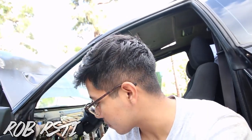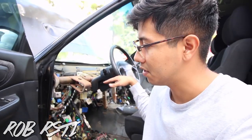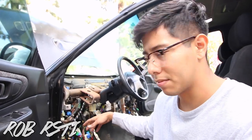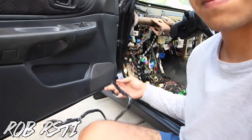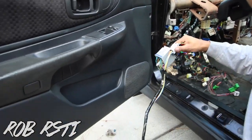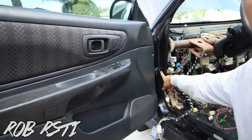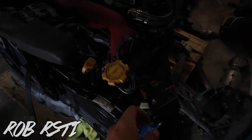I'm gonna be doing the fuel pump last. I'm not gonna be plugging in the driver side because I'm gonna have to remove the steering column from the steering rack and unplug it and redo it again, and I don't want to do double the work. Also, this wiring right here — this long one — has to go through the fender. I'll show you why. It goes through the fender and comes out on the JDM side. This is like the 05 STI — it has these two plugs on the fender side that plug into right here.